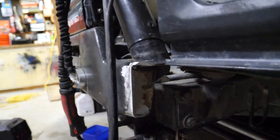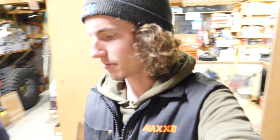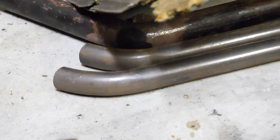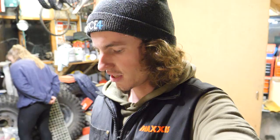Right, well, we've got the bumper plated off on the ends. Came out looking really tidy, ground it back. And the next step is to cut the 32 nominal bore pipe for the top bars. I found some pre-bent pipe floating around, which is fortunate because I went to grab a stick of 25 and found that I've run out. So that's pretty fortunate because that would have been a bit of a pickle. We'll use those pre-bent pieces for the bottom and then we'll use the 32 for the top. So cut a stick at 1400, chop it in half, smack it in the bender and yeah, get going.